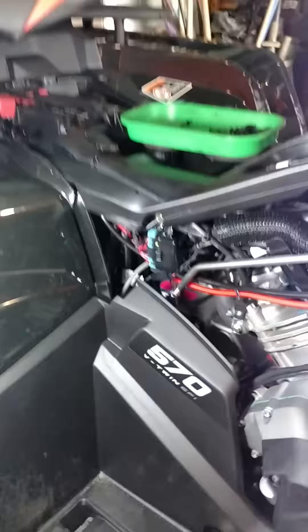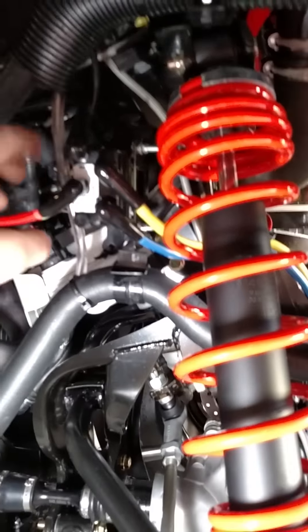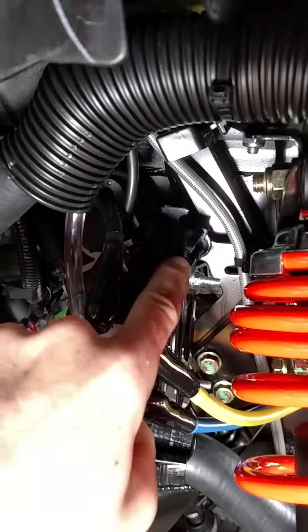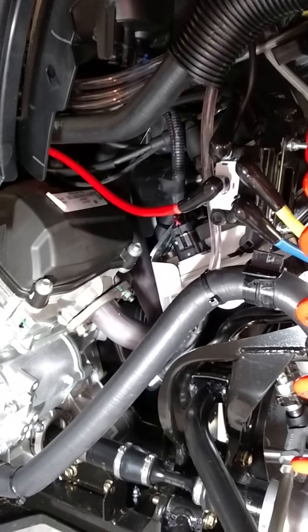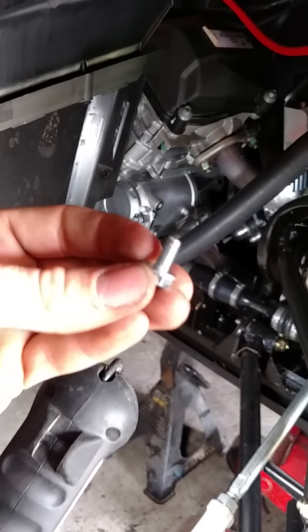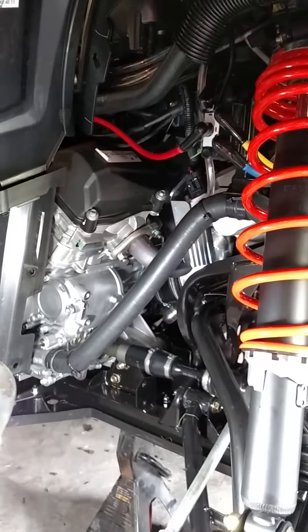There is a contactor switch inside here that you won't be able to see, but it's back here behind your rear fender. I like this about it a lot. Usually your contactor, or solenoid, is sitting back there with your battery, but there's actually a triangular-looking bracket that it specifically sits on. You can see there's two bolts that go there and then one bolt down here — which you can tell those are zip ties holding it in because there are no threads on mine. I don't know if it just didn't come from the factory or if these bolts are supposed to self-tap, but that does not look like a self-tapping screw to me. This is what happened to the first one I tried to put in there — as you can see, there's no threads left on it. So that idea was scrapped. I had enough zip ties that I just figured I'd zip tie it in there, but it's nice and secure. It's not going to go anywhere.